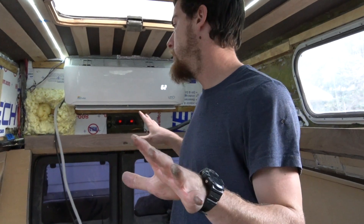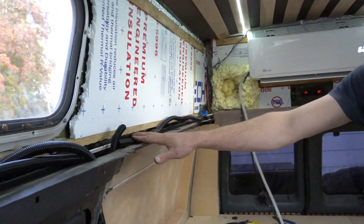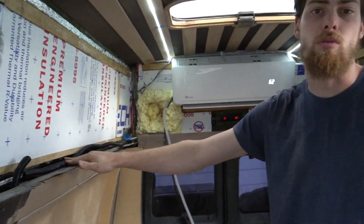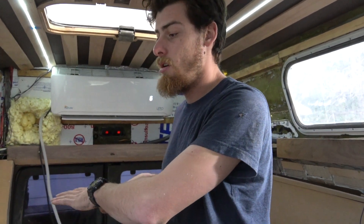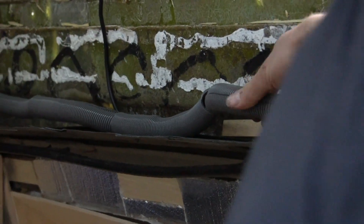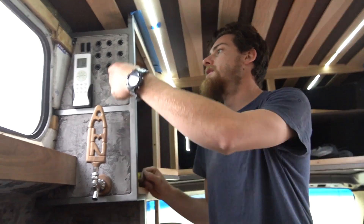We have a bunch of wires running throughout the van. We couldn't get rid of this stuff up here because of the van's structure, but it made a perfect guide to run all of our wires. All wires are tucked into these looms because they're sitting on metal — we don't want them to chafe and cut through. In case they do, everything is on its own separate fuse so it'll break the fuse before lighting something on fire. All power wires run into this gray loom down to the switchboard.